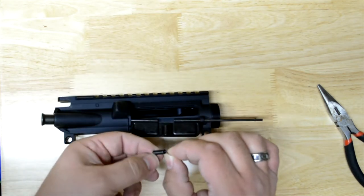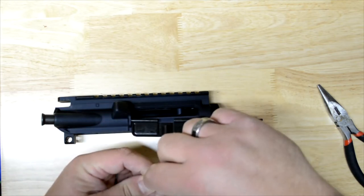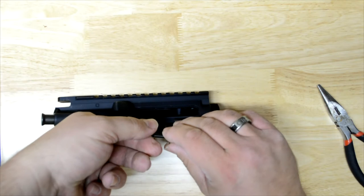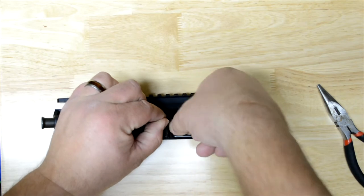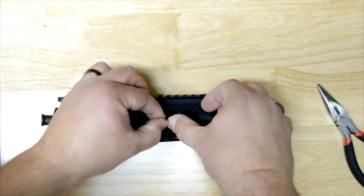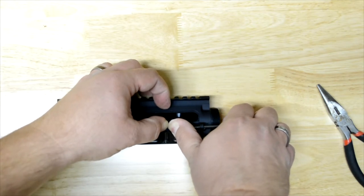You could do it the reverse way by holding the short end and winding up the long arm 180 degrees — same way, if you look down on it it's going to be clockwise. Personally I've found more success by winding up the short arm, because the long arm is easier to hold. You rotate 180 degrees, rest that long arm against the door, and that long arm goes right into that groove. The whole time it's going to want to fight you, so you really have to keep your thumbs in place and use your pinky or other fingers to guide the rod in.